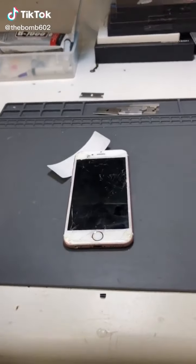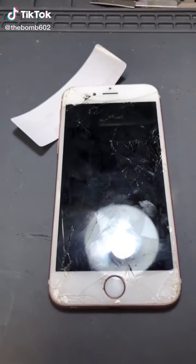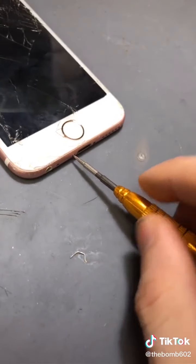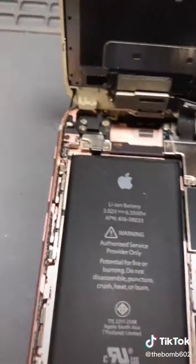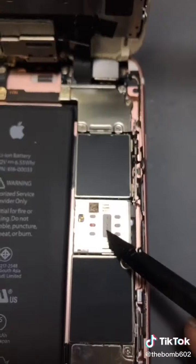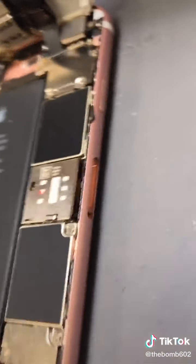It's been a little while since I've done one of these. iPhone 6S screen replacement — screw, screw, screw. I'm going to use a razor blade to open her up. She opens up with the cables at the top. The owner of this phone told me they just stuck the SIM card in without the tray, so I have to get that out as well.